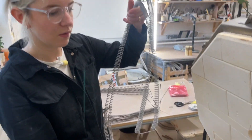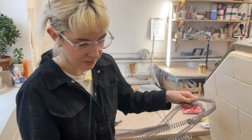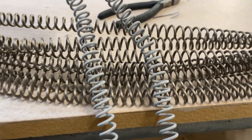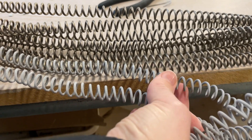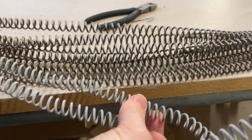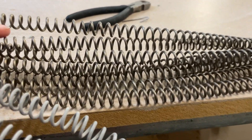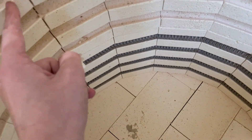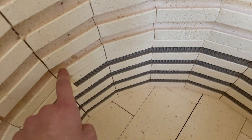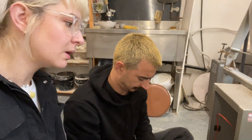Here's the first bank of used elements and if we compare them to the brand new ones, you can see they are vastly different — there's a whole lot of different color here. This is oxidation on the elements from heating up and cooling down so many times, and these new ones are fresh. While we're in here we can get rid of all this debris — I think a pot exploded at some point — so I'm going to get my little brush and get all of this out so it doesn't damage the new elements.